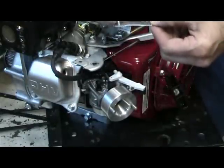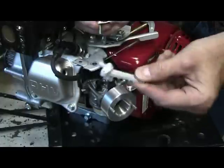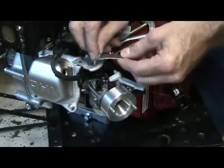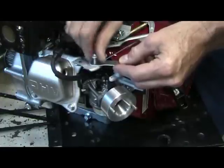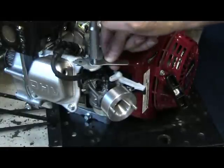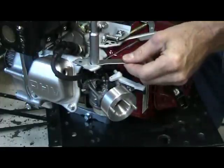What the choke tab does is it uses the bolt that came out that holds your air cleaner on — it holds this choke lever on. It's very easy to install. You'll use the existing bolt like we talk about in the instructions, and I'm going to use a wrench here just to snug it to show you. You'll screw your bolt in and get it relatively snug.